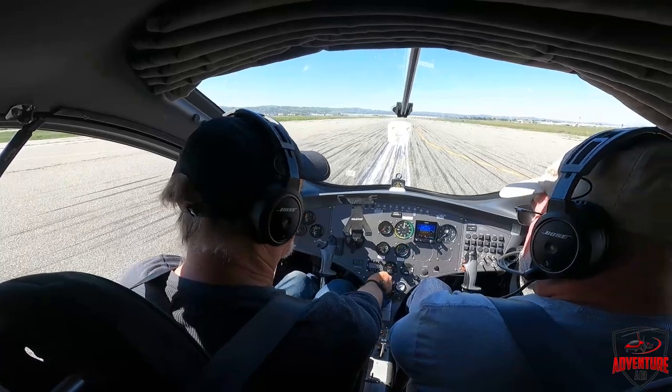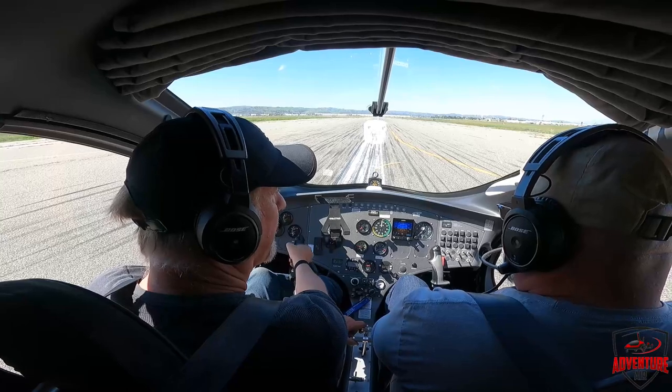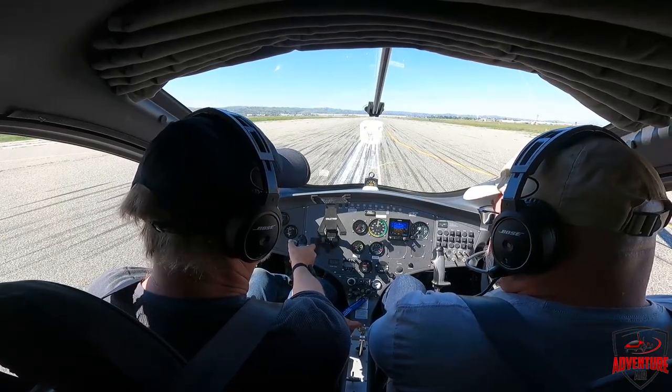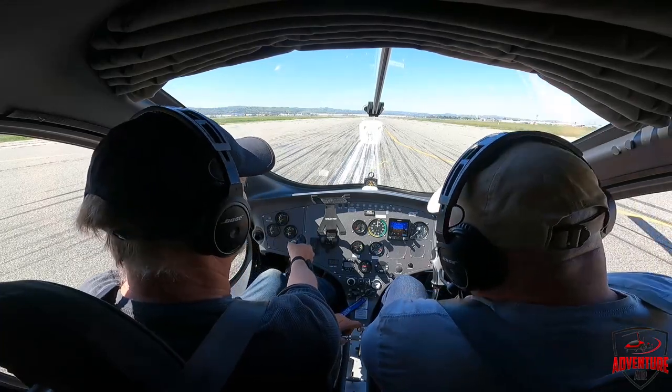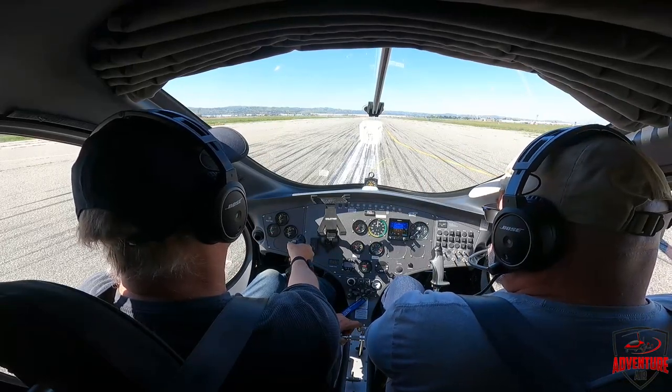The first thing we do is remember we have the rotor on brake mode, so I'm going to go ahead and go to flight mode. Keep your hand on the stick — it will move around really freely. Then I'm going to increase the throttle up to about 2,000 RPM. With my thumb I'm going to push down on the pre-rotor button — it's that one right there — it grabs the blade and starts spinning it around.